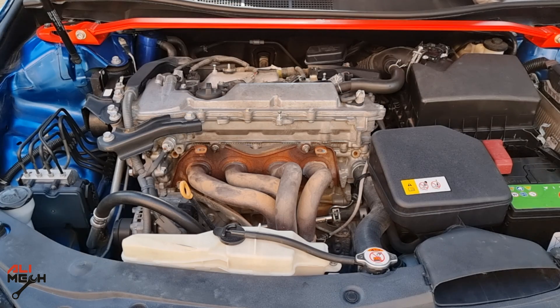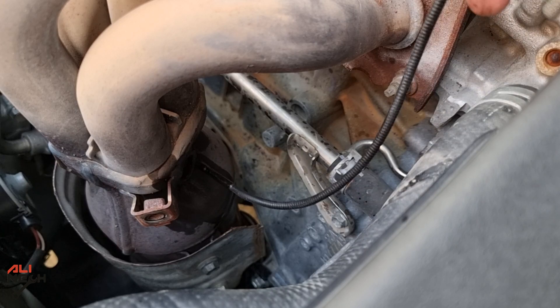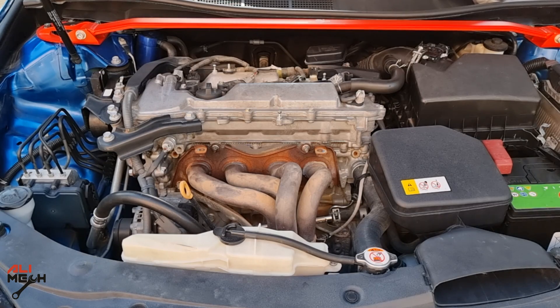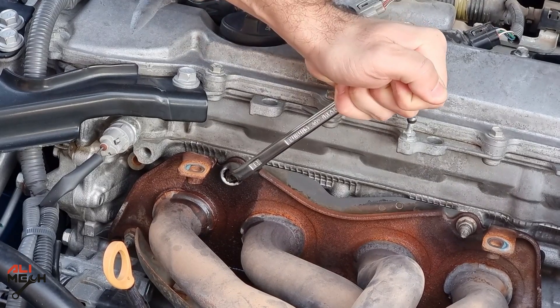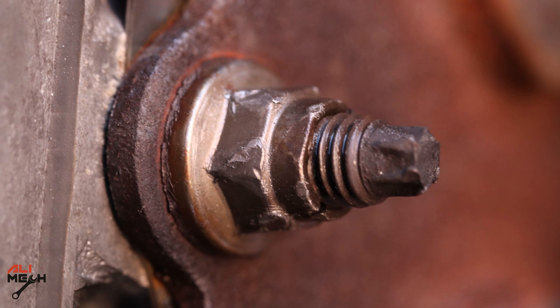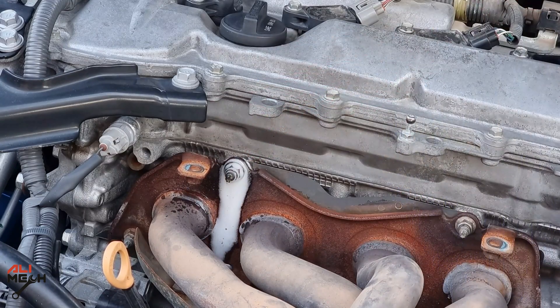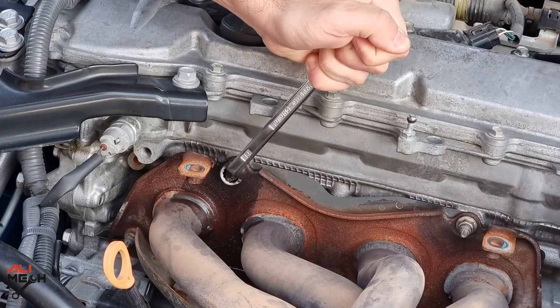Hello. So I'm about to make a video on how to clean exhaust valves and intake valves with walnut shell. The scope camera was so hard to reach the valves from the oxygen sensor hole — it was so difficult to pass that curve. So I needed to remove the exhaust to take good quality before and after pictures and videos. This is a problem I'm facing right now undoing an exhaust nut. That's pretty normal for a part of the engine that heats up and gets cold all the time — removing them will be hard, and sometimes it will break the stud if you are not careful. Even I used WD-40 and let it penetrate for a while, but it was making the same sound. So I didn't take any risk to break that stud.